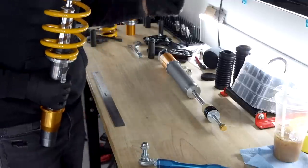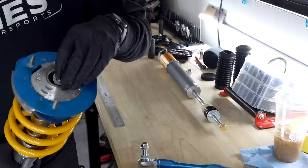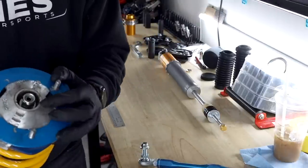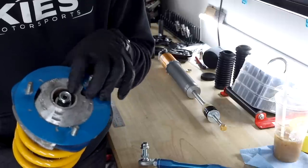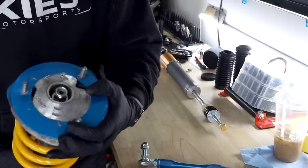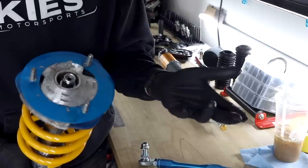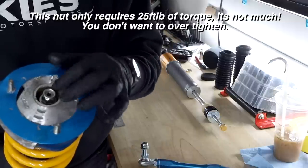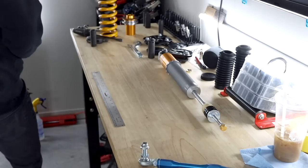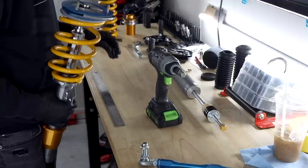So now we have a washer, and one washer, it's going to go onto the top, right there. And then you're going to have your new nut. When it comes to tightening these down, technically you should have a pass through socket that allows you to hold the Allen on the top here down so it doesn't spin while you do this. I have learned that with an impact, you can smoke it through fast enough that it's not going to spin. Might a little bit, not a big deal. Technically, you should have a pass through with an Allen wrench holding it still so you can tighten it all the way down. I ordered one as well, but it is not here yet. Being that this isn't the final installation, we're really just testing things out and seeing how it's going to sit. We're going to just go ahead and smoke it.